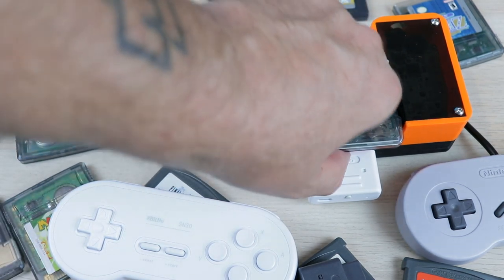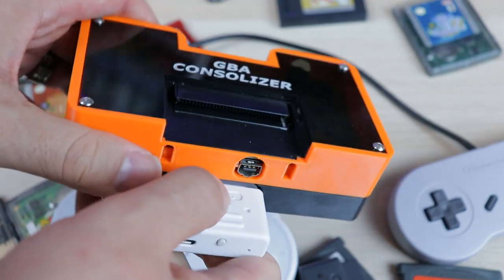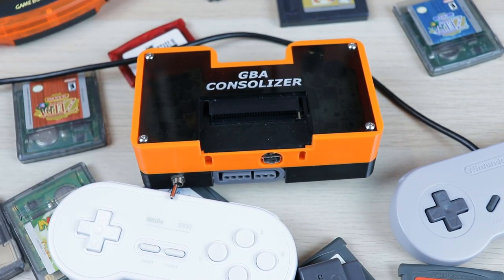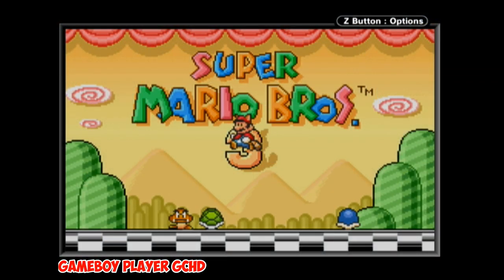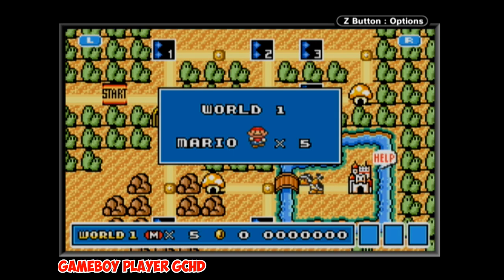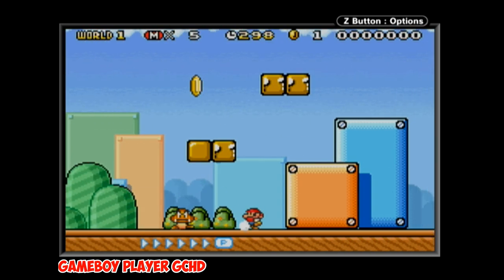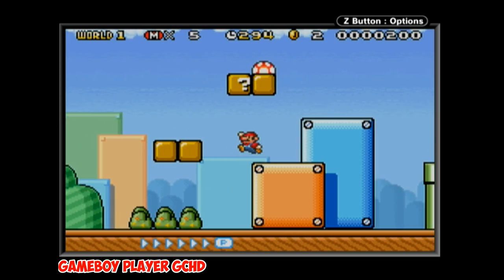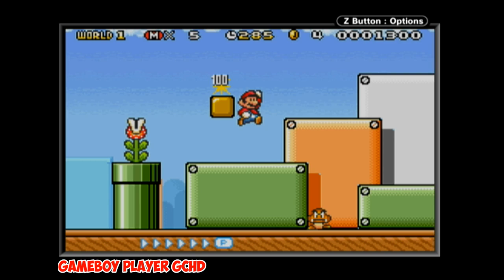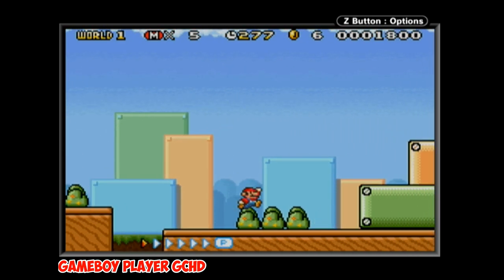I've tried the Consolizer on several TVs without any issues. However, as a YouTuber, capturing video did have some issues with my capture card — the system needed some settings tweaked. There's a DVI plus mode I needed to disable to get visuals through my capture card, and I had to use a 3.5mm auxiliary cable from the headphone jack for audio. I had no issues with DVI plus mode on any of my other displays — this was just a capture card issue. Depending on your TV, this may or may not be a problem, but it seems to be an issue for people wanting to capture gameplay.